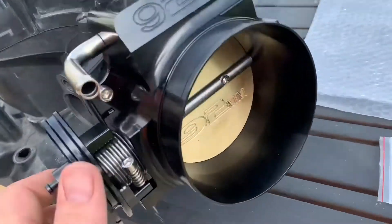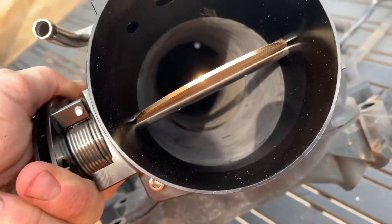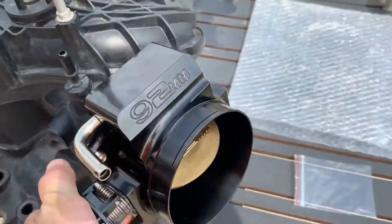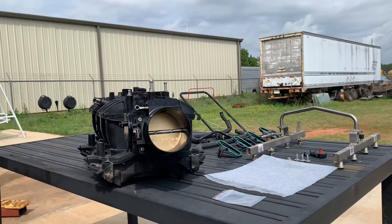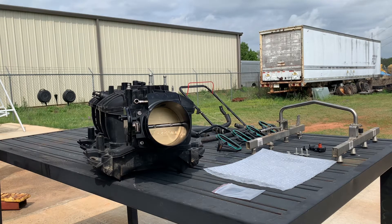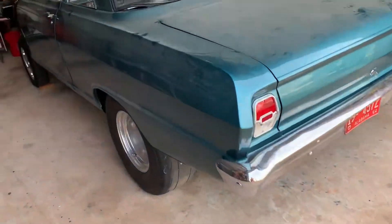All right. I don't know if y'all can see that very well, but we have no more lip. There was about an eighth inch of lip all the way around the inside, and that would have just been - it's basically like creating a wall that's going to create turbulence. Whenever you put a bigger throttle body on there like that, same thing when you port a set of heads - if you do the exhaust manifold or the exhaust port larger than the headers, you're hitting a wall. Let's go look at a set of those so I can explain that better.